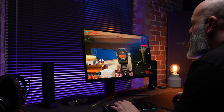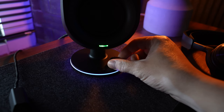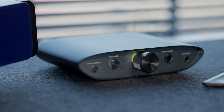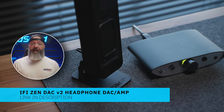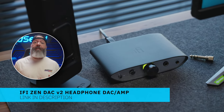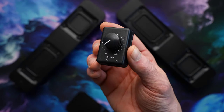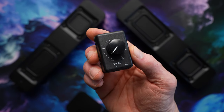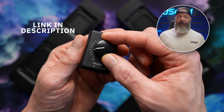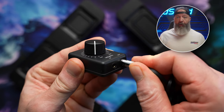Even when I'm playing single player stuff, I have a tendency to ride the physical volume control on my speakers as scenes get louder or quieter. And the physical multimedia controls that you get on some keyboards don't always behave the same way in-game as they do on the desktop. One workaround is running a desktop headphone DAC amp that has outputs controlled by the volume knob, but I only recommend this to people who really know their gear because it's really easy to overload a powered speaker by sending additional power to it. With some hardware like the iFi Zen DAC V2, which I still highly recommend, you completely forfeit any control over the Windows digital system volume just by using it — so this is still very much a workaround, not an ideal solution. This vol box is another helpful little piece I use with desktop monitors that only have volume control on the rear of the speaker cabinet — it just sits in your input chain. It's a bit pricey for what it is at around $18, but it's a lifesaver in certain audio setups and great if you need to add some cable length between your source and your speakers.